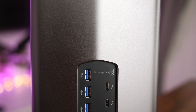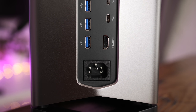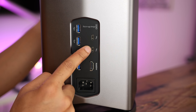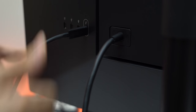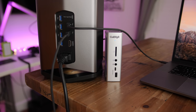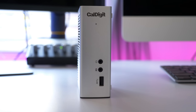The Blackmagic enclosure provides users with full charging capabilities up to 85 watts, four USB 3.1 Gen 1 ports, and a single HDMI 2.0 port. The HDMI port can be used for accessories such as VR headsets or an HDMI-enabled display. What's particularly special is the extra Thunderbolt 3 port, which can be used to drive the LG 5K UltraFine display. Under the right circumstances, it can be a true set-it-and-forget-it solution for professionals. For those opting to connect to an HDMI display, the extra Thunderbolt 3 port can be used to daisy-chain additional peripherals such as CalDigit's TS3 Plus Thunderbolt 3 dock.